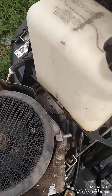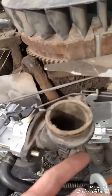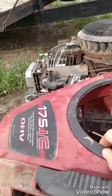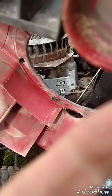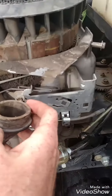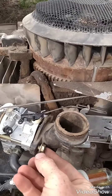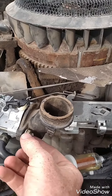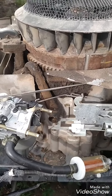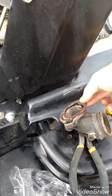You've got to take the oil cap off so that it can slide out. I just take all this off — it's just easier so it's not falling all over the place. Then give it a couple of little pulls and it pops off. I would put your dipstick back into it. This hose was connected on the underside. Here's the top part — it sits like this on the lawn mower; that's where the air intake is. You have to wiggle it back and forth when it's on there. There will be two nuts, one on each side — you have to undo the nuts. Then you pull this air intake out. There will be a little red gasket that fits down inside of there — don't lose that.